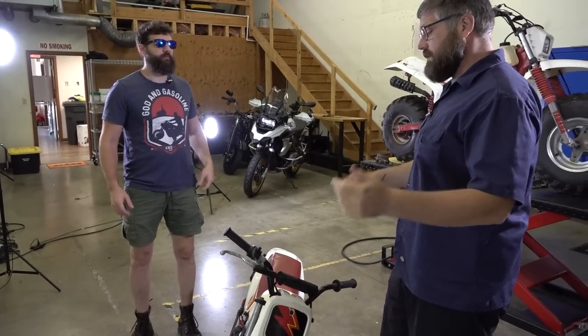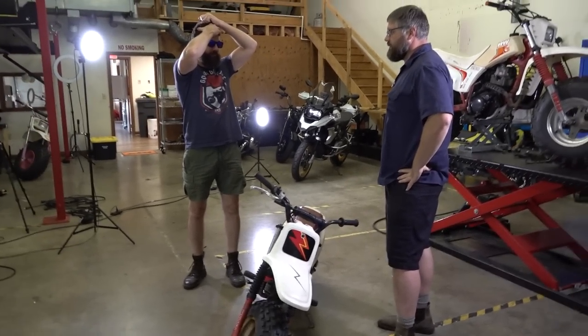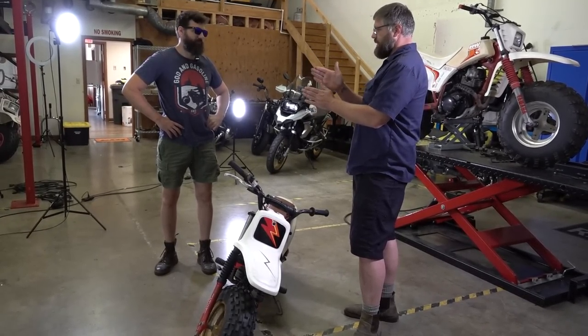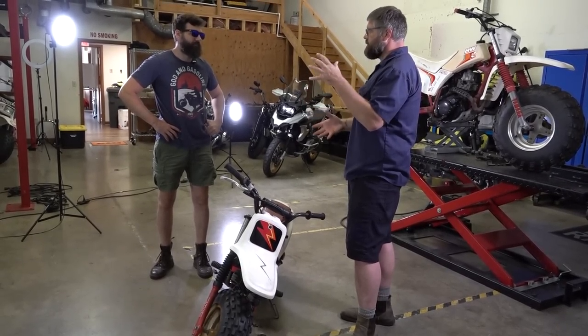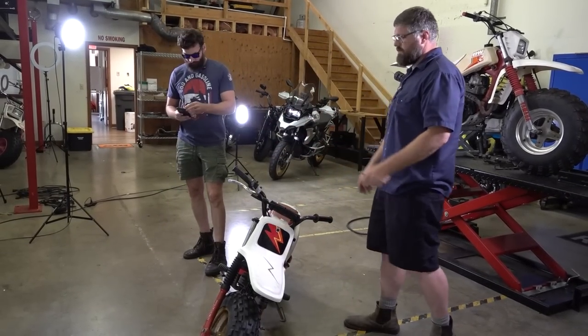I either want to see if we can talk to Chad, if he'll finish it. What's the actual issue? So it's spacing. You have to get the hub spaced right. If your rim's here, you have to get the hub spaced here and also get it true. So it just adds a third dimension of truing, and it's a lot of back and forth. I get it close and then it comes out. They're interesting.